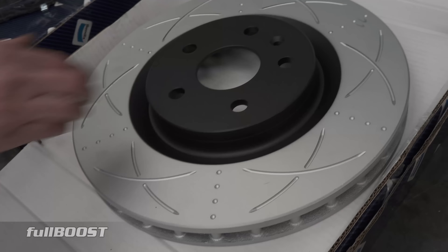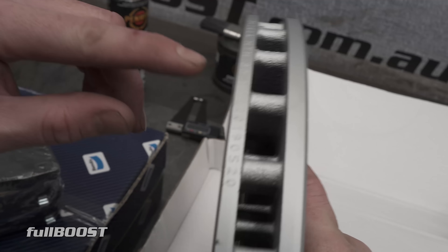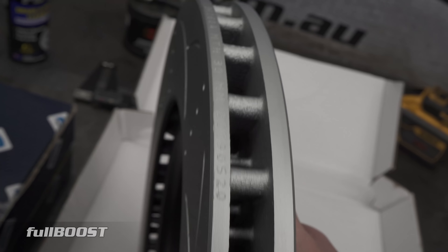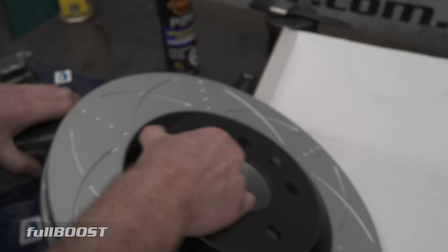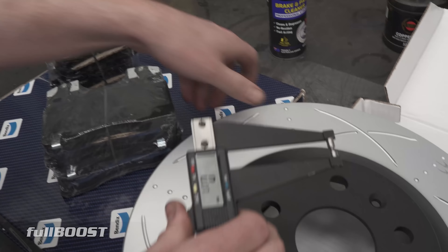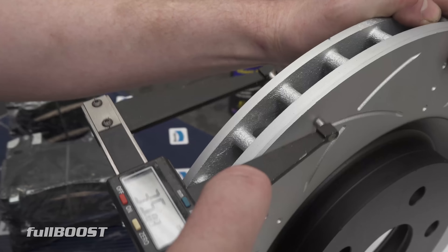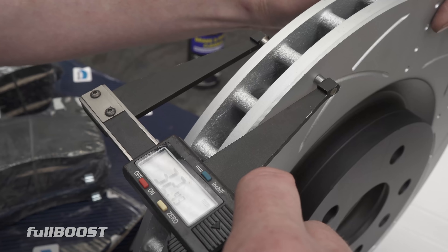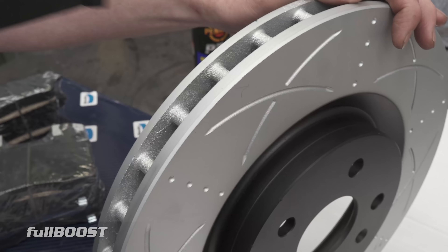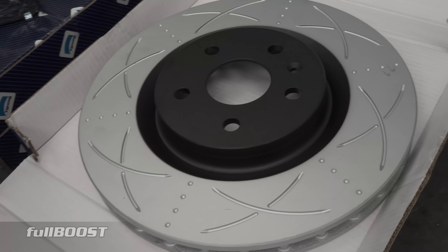These are definitely the front ones. They look big off the car - they don't look that big on the car. You'll see here it says 30, so 30 millimetres is the minimum. These are some of the tools you might need to service your brakes - this is essentially a disc rotor vernier caliper. If I put that on there you can see that's about two and a half mil or so, so it's 32. So if you were to get these on and check the old ones when they come off, if they're below 30, you know it's definitely time to change rotors. If you go to get your car serviced somewhere and think they just want to scam you for changing the brakes, ask them to show you that measurement. If it's below what's stamped on the outside of the rotor, you have to change them.